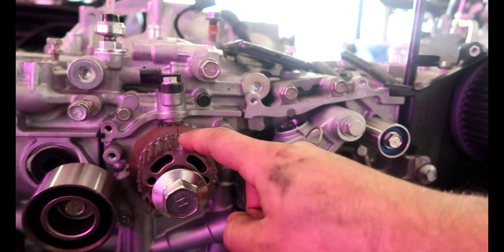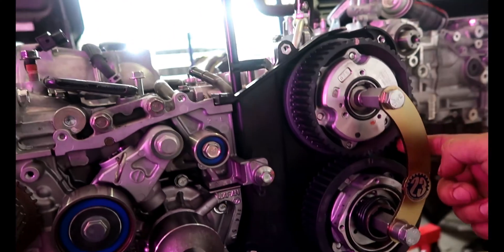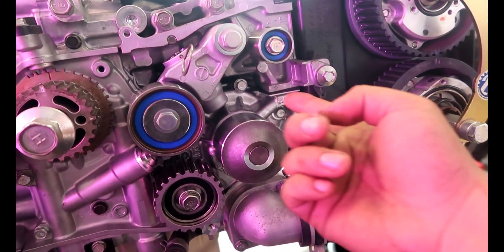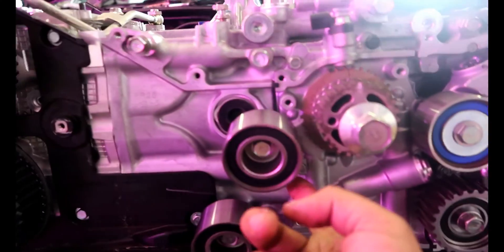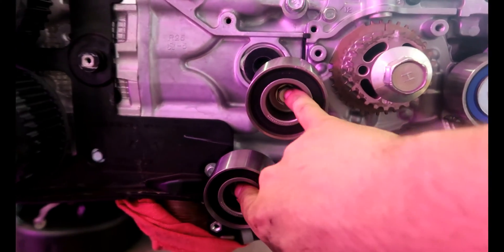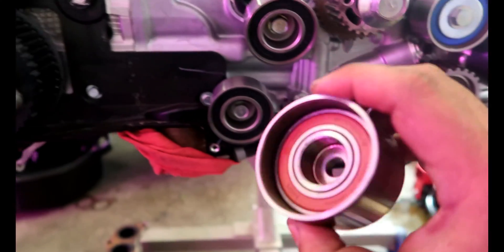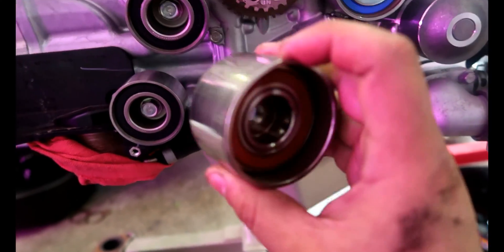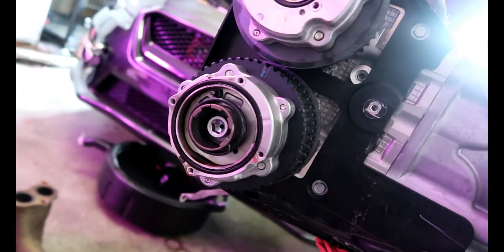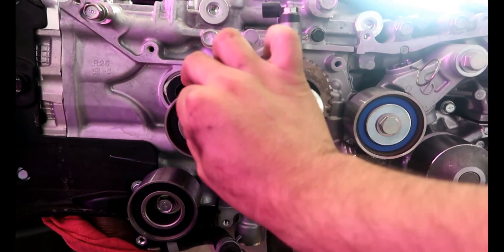The belt has a marking itself — a dotted line — that's for the crank. Once you go under, over this, over the belt, over the cam gear, the other cam gear, down here, and then over this pulley, that's the routing. Also, if you're doing a timing belt and you see one of the bearings looks more recessed — it doesn't really matter, they're only the same size. If you get two of the same ones, don't worry thinking they gave you the wrong pulley — it's the same thing.